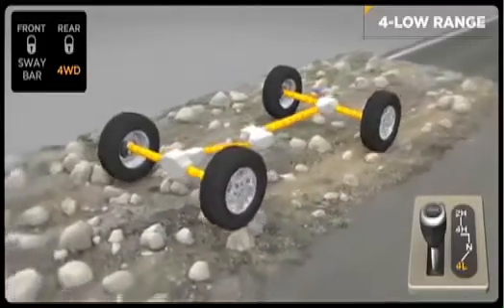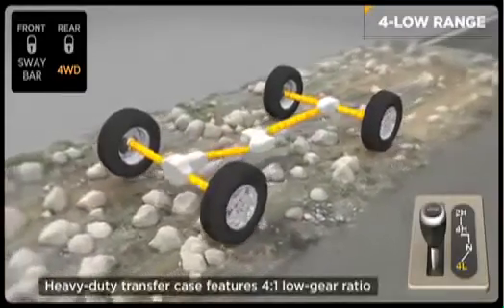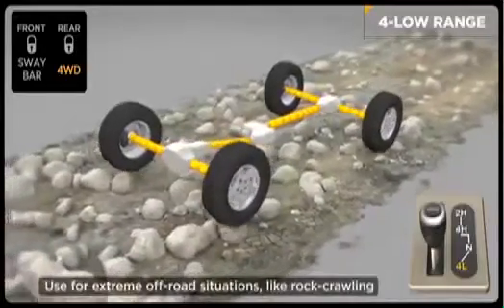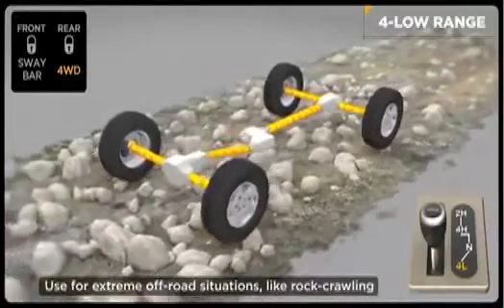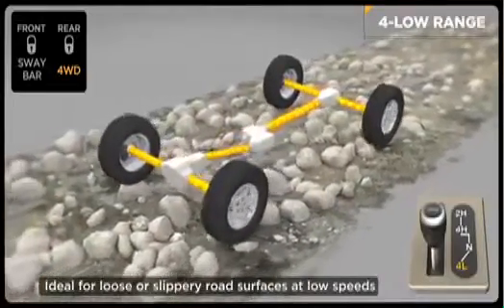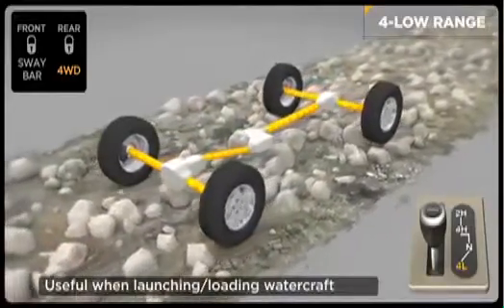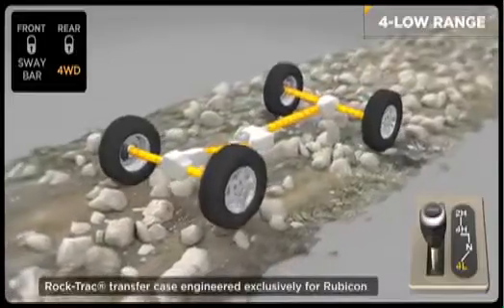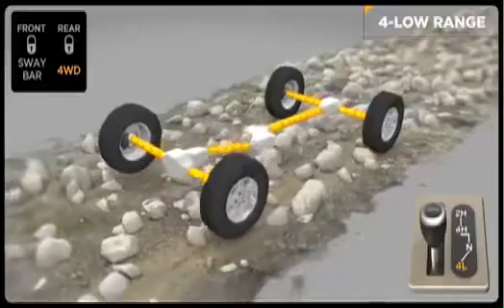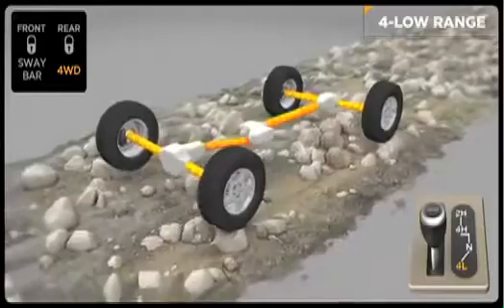Four low range is where RockTrack really struts its stuff. This heavy-duty transfer case boasts a gutsy four-to-one low gear ratio — the magic number in the off-road world — to deliver massive amounts of engine torque for rock crawling. An exceptional 73.1-to-1 crawl ratio with a manual transmission allows for a controlled one-half mile per hour cruise up the rocks. RockTrack is designed exclusively for the Wrangler Rubicon and the Wrangler Unlimited Rubicon and operates in conjunction with other hardcore off-road components like locking axles and beefy driveshafts.